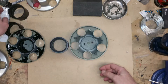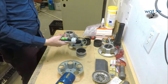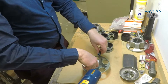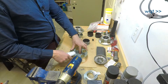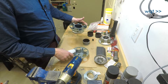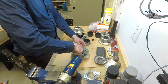The next step is this nifty stuff here - this is 3M black super weatherstrip and gasket adhesive. This is a somewhat runny polyurethane adhesive, which is a relative of what you would use to secure a windshield, but it's not quite as tacky. You're supposed to apply it and then let it tack up for a bit before actually putting things together. I don't want to actually seal over this spot right here because if I do and I ever had to pop out that Jeep center cap, I'd never be able to get to it again - there's just enough room to get a screwdriver in there if I really had to. I also want this screw to be pointing at one of these little prongs and not at one of the screw holes. So go ahead and add a generous portion of adhesive down in here.